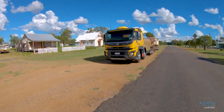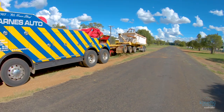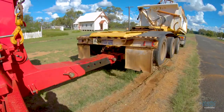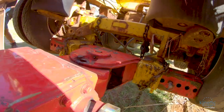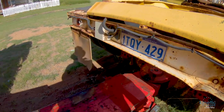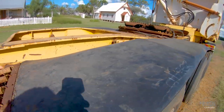And over on Maddie's truck, we've got a standard T-bar hookup. Maddie's under there getting dirty and I'm not helping him, so he wouldn't be happy. But standard big half moons around the axle, usual drop chain, and then a winch up. Oh, he's going to do an over centre dog. So he's dogging that chain.